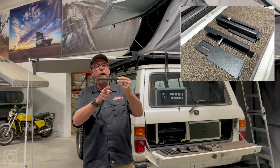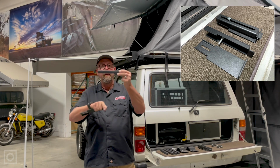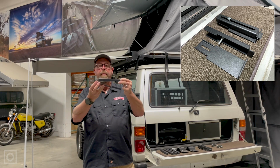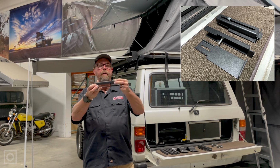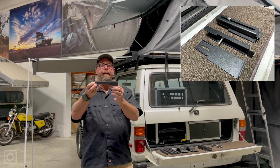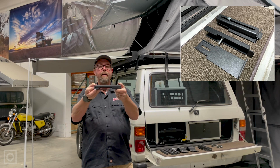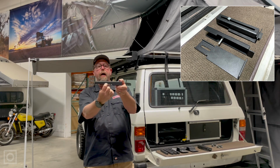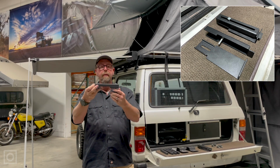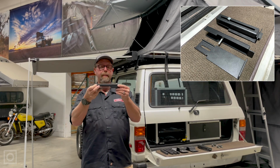So when you lay that down on there, this will mount in here. The slat will lay right here. It'll sit on the roof rack system. This bracket will come in, clamps onto that tab, go over here. We have a carriage bolt that goes down through, and that clamps it around the slat of the K9 roof rack. So your slat is actually in this slot right here, running front to back. You have 4 of these in position. That holds your hard shell rooftop tent to a K9 roof rack system.